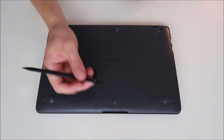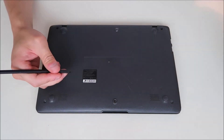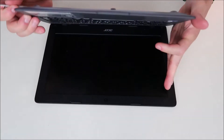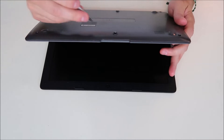I'm going to use my small flat pry tool to take off these rubber stoppers — they're usually just held on by double-sided tape. After that, I'm going to take my small flat metal pry tool, go along the seam of the bottom case and the palm rest, and pry them apart.